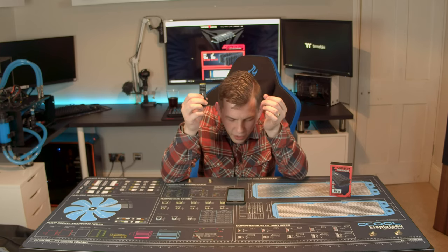It also comes with 512 megabytes of DRAM cache. This is one of the things where if you look at the really cheap drives, that's one of the things they skimp on — things like cache. They also use cheaper controllers. This drive uses what I think is called the Phison E12, which is basically the controller used in all of the top drives. So with cheap drives, the reason they're cheap is lack of cache and lack of decent quality controllers — that's where this one comes in good.